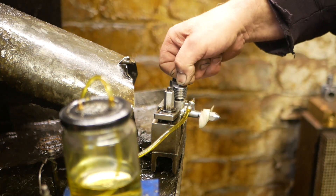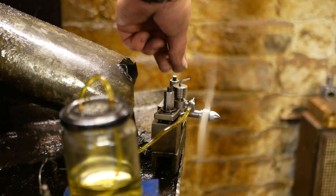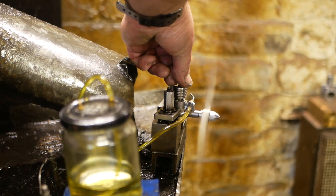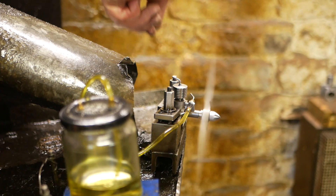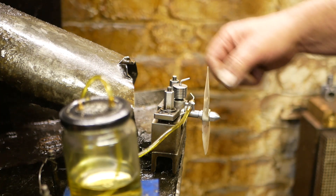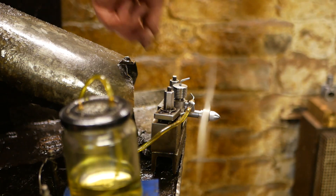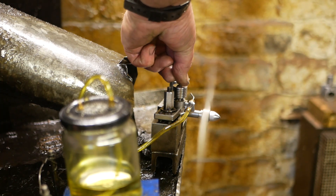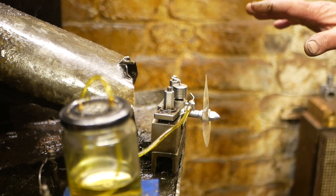So there we've stopped it. Turn it back and now we'll find the optimum setting. That's about the optimum setting. It's bad for the engine if it's over compressed. I'll now demonstrate over-compressed running. To start again, turn the compression back to the starting position. You notice when I increase the compression you could hear the engine revs die and the engine start to labour.